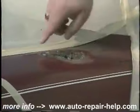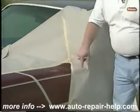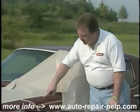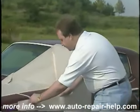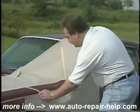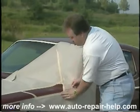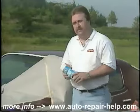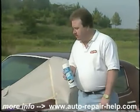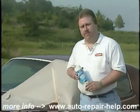What we have here is your typical rust out. As you can see, the paint bubbling here, and in some cases the rust is already completely through. What we're going to do is finish masking this area off and use our total prep to clean the area to be free from wax and grease that might prevent adhesion of the filler, the paint, or the primer.